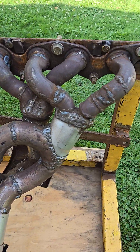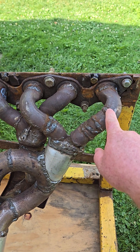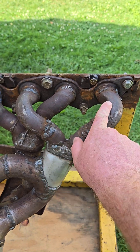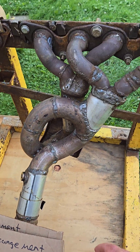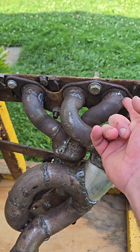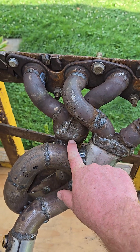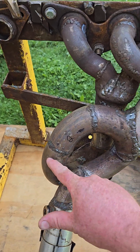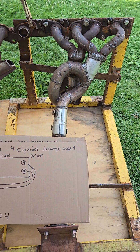I've created this header so that cylinders one and three — the short pair — exit through the flex pipe first, and then four and two exit as the long pair. The pattern repeats over and over again, recreating those same two short and two long pulses.